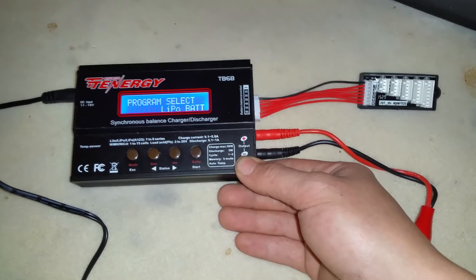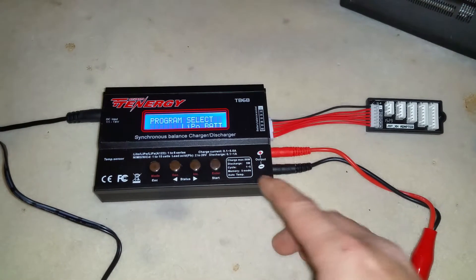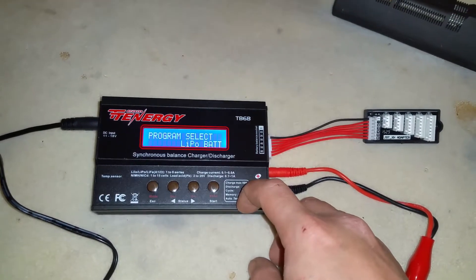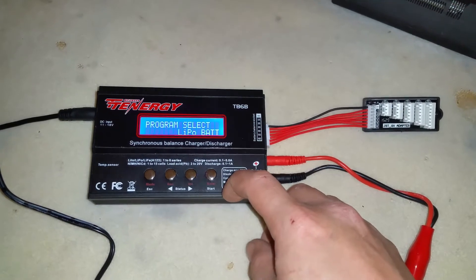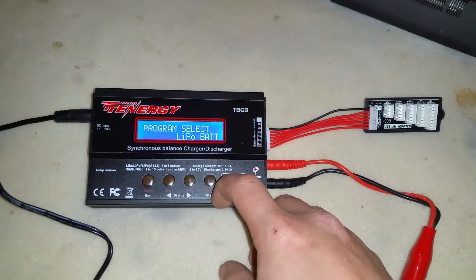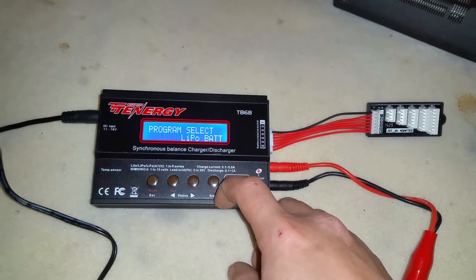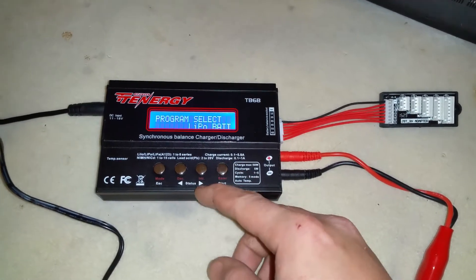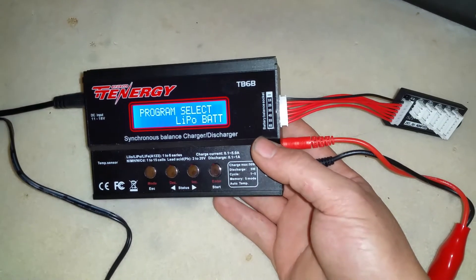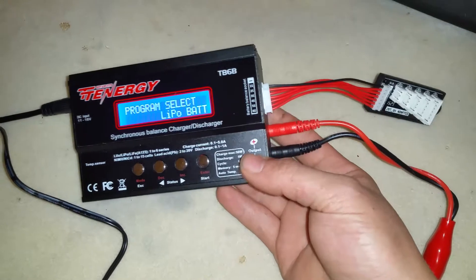Anyone with an X-Maxx or a large vehicle like the Axial Yeti XL needs two batteries to run on 6S. On my X-Maxx I'm using two 7500mAh 3S packs, so I'm running 6S at 7500mAh 30C — that's a constant discharge of 225 amps, with a peak of around 350-375 amps. That's why I got this charger, since I only had one LiPo charger from when I got my first RC vehicle.